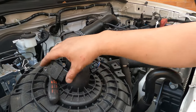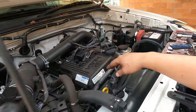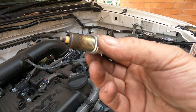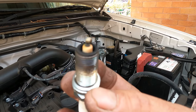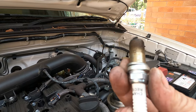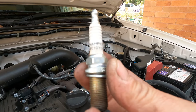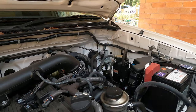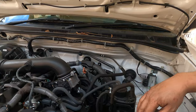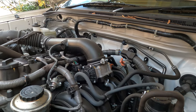We'll replace the air filter, clean out the air mass sensor, and check the spark plugs. We have to replace the spark plugs because this one is worn out. I don't know why people use Champion brand — up to you — but for me I always use NGK or Denso. Denso is the genuine Toyota or Japanese one.